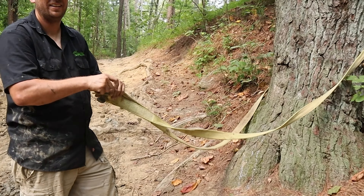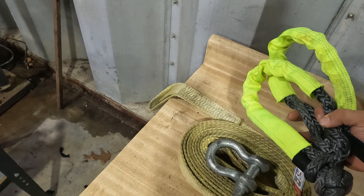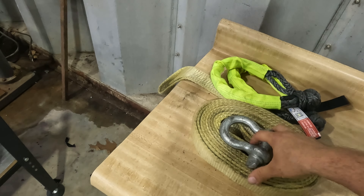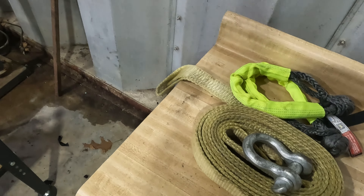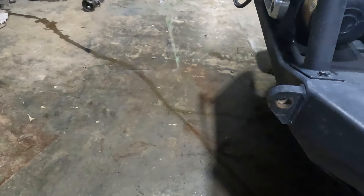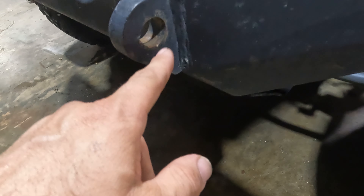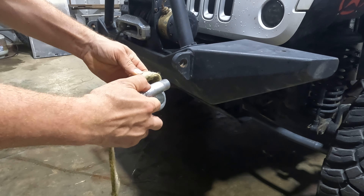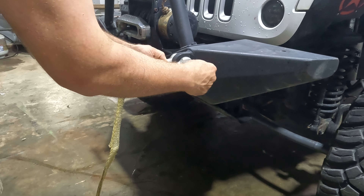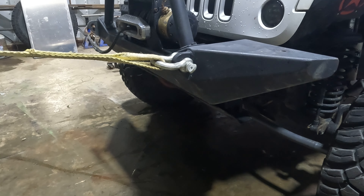Next, with your recovery gear, are hard shackles or soft shackles. There are some do's and don'ts — you can't always use these in every situation. Soft shackles are a lot safer; if they break, it's much safer. But if you've got D-ring slots in your bumper, do not use the soft shackles in those — the edges will cut them and there are multiple videos of people getting hurt. With a hard shackle, pull your pin out, fill your strap, attach your D-ring, and you've got a good pull point right there.